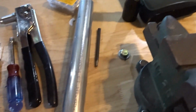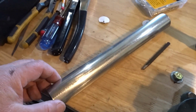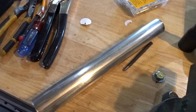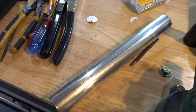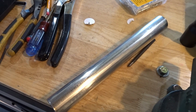And I think what we're going to do today is I do have one piece of stainless tubing here, and I'm going to go ahead and make this either for the top hose or the bottom hose. I haven't decided yet, but we're going to measure this to length. We're going to bead roll the ends to put beads on, and we'll get started on that.